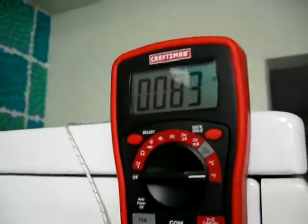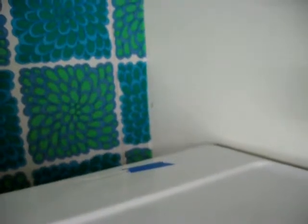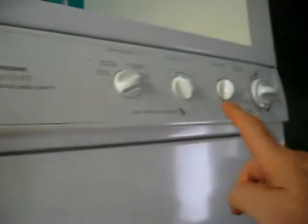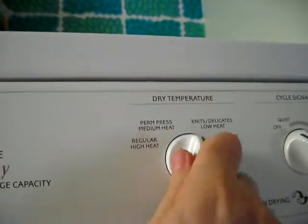There's a temperature meter on top. Right now 83 degrees Fahrenheit. It's measuring the temperature in the back corner of the top of the dryer, which is over the thermal fuse. If it gets too hot there the thermal fuse will blow, costing money. Just a few towels in the dryer. Let's close the dryer door, turn on the dryer, and set it from heat off to high heat.